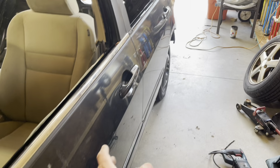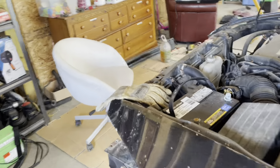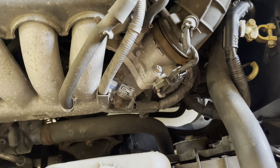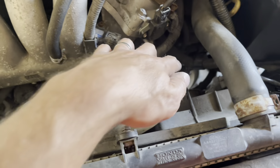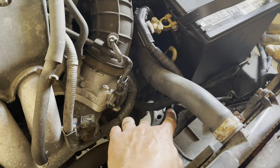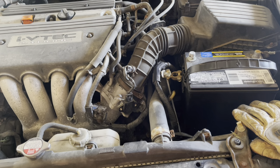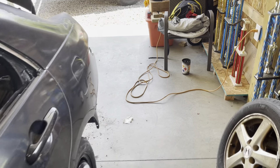Muffler underneath — I'll cut it and get it off the jack stands. Up front we're going to get the transmission hoses taken care of. You've got to loop them so that if you get punched in the radiator you're not going to lose fluid — there's one going in and one going out, and I'm going to loop them right there shortly.